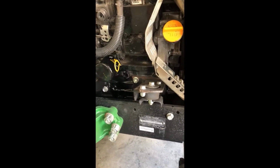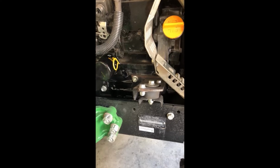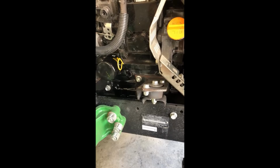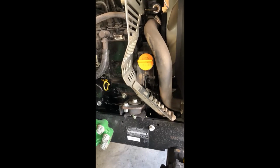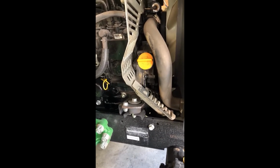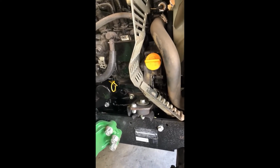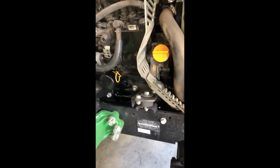But overfilling is actually a bad thing, especially any engine with oil. You have too much oil in there, that can actually cause problems. You can spin bearings, it can do things. So that's why I don't go just exactly by what they're telling me. I like to put it in by feel, checking, things in that nature. And I'd rather be just a shy low than actually too much. But you do what you want, and I will put the manufacturer's specs in at the end of the video.